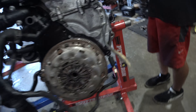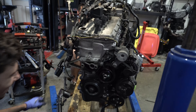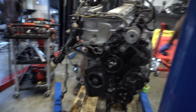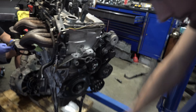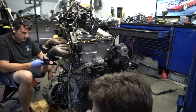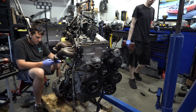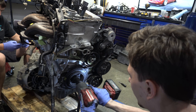We've got the engine harness installed, lots of accessories, clutch and flywheel, oil pan, oil pump all swapped over. Now we're torquing the crank pulley - the way I do it with the transmission up, I thread an M12 bolt into one of the holes and lock it with a shouldered M12 bolt on the starter to hold the flywheel. Initial torque is 120 Newton meters, then we mark 12 o'clock and do a 90 degree turn. Most people replace their crankshaft bolt, but we're reusing ours.